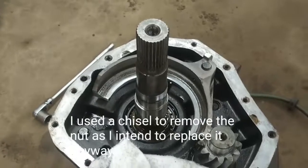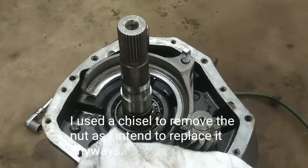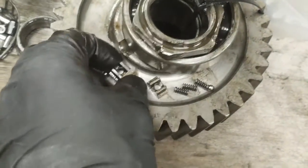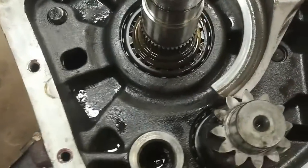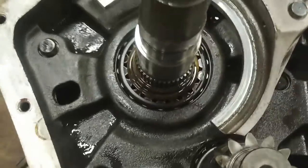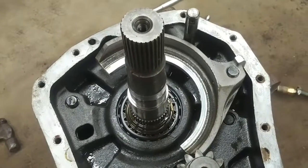I got the output shaft nut off — it should be replaced, I don't think it's supposed to be reused, hopefully there's one in the kit. When you remove the reverse gear synchronizer assembly, the blockers and check balls will fall down. I'm missing a check ball — I believe it fell into the transmission. I found one ball over here and another over here, so the third would have been in this vicinity. We'll keep an eye out for it — hopefully it's in the kit anyway, so it's irrelevant if it's new.